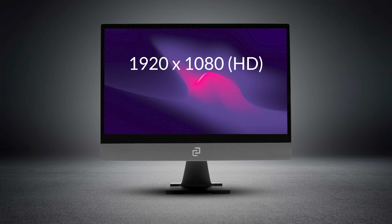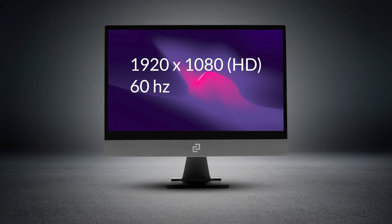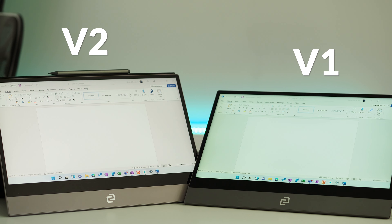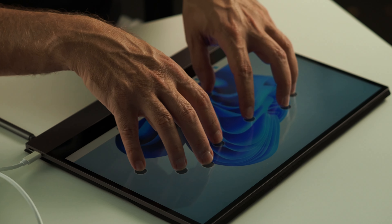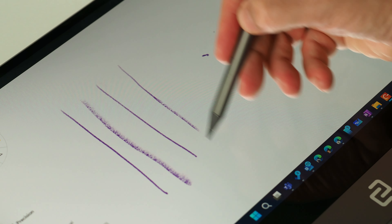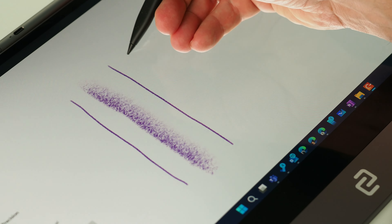The display has a 1920 by 1080 resolution, also known as 1080p or Full HD, and it runs at 60Hz. The standard color setup has been tweaked nicely to give it a slightly more blue tinge. The display supports at least 10 simultaneous points of touch, and it even supports tilt with the Espresso pen, as well as any one of the more recent Surface pens from 2017 onwards. It doesn't appear to support haptic feedback with the Surface Slim Pen 2, but the Slim Pen 2 does work quite well on the screen.